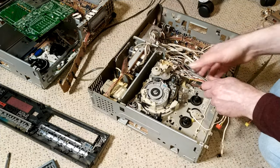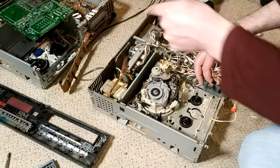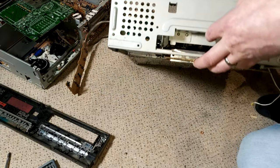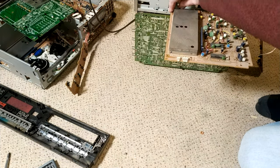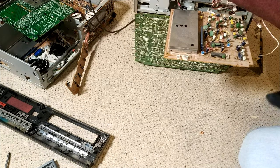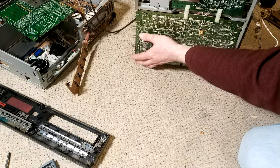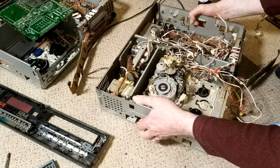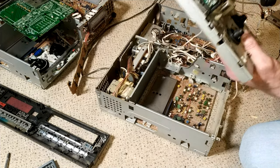So that's all the cables from the side and top of the deck free. You'll notice that I have actually unplugged all the reel table ones as well, even though I'm going to recycle the reel table from the old deck in the other C30. So I just have to do under the deck — I'm unplugging the connector for the video heads. It's quite good because I've got a good collection of boards now, not that I'm terribly sure I'll need them.